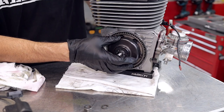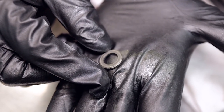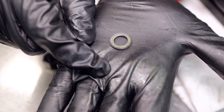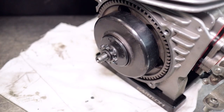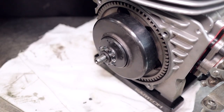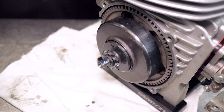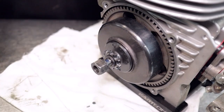Slide the clutch drum back onto the clutch assembly. The external thrust washer has got some wear on it from where the sprocket's been running, so we're going to replace that while we're at it. Slip the brand new one onto the end of the crankshaft and use a tiny bit of Loctite — just a drop on the end of the shaft. You don't need too much or it'll gum up on the washer. Spread it with your finger, then do up the clutch nut with a 17mm socket.